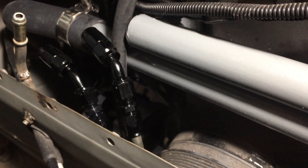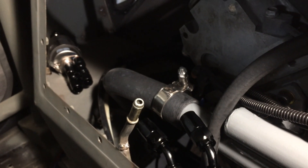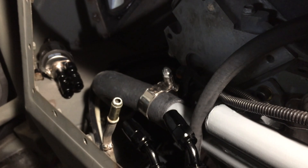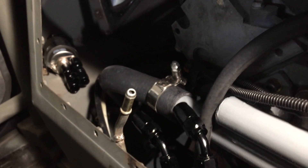I've reinstalled the gas tank. Those are my two compression fittings for the feed and the return line, turning off to the left where I have that fuel filter slash regulator. I've already made my measurements between the top two, so we're going to go over and cut them now.